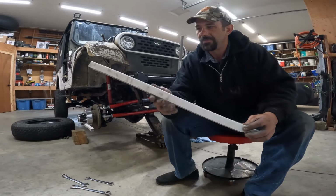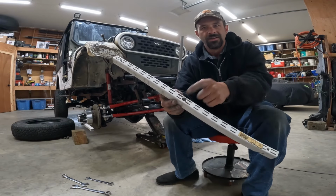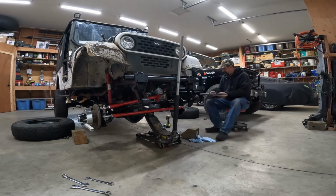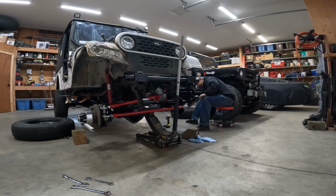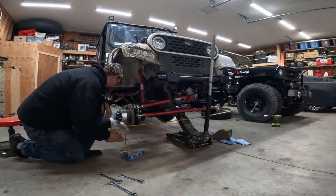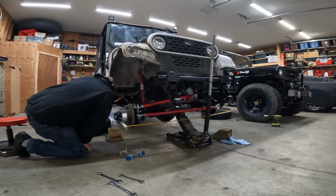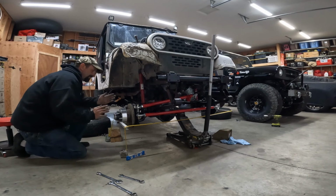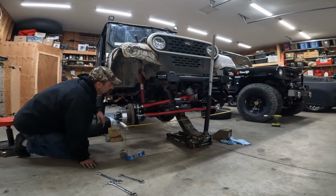All right, a couple of shelf brackets sitting there. They look nice and straight, so drill a hole in the center, slide over a lug nut, snug it up. And we will be getting somewhere. We're lining this thing. 59 7/16, and 59 1/4. So it's toed out right now. That's not what we want. We want it toed in.